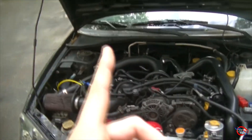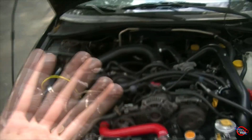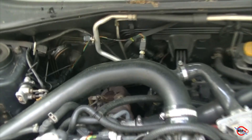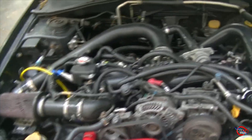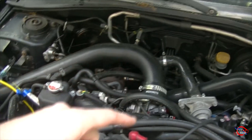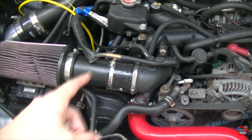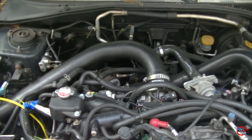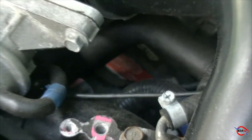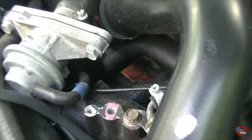So to avoid this problem, you want a good tune, stronger pistons, and speed density if you can. Because the top mount intercooler — it really should be called the hot mount intercooler — but you can see here that I have an intake air temperature sensor wired up to the Link G4 Plus ECU. So the ECU knows exactly the charge temperature coming in and it can retard the timing accordingly. Whereas on the top mount cars you can install that, but almost all of them run off Subaru's MAF. My car doesn't even look at the MAF anymore. I took the precautions and bought an IAG Stage 2 block instead of another OEM block, which I'm very glad I did now that I've taken the old engine apart.